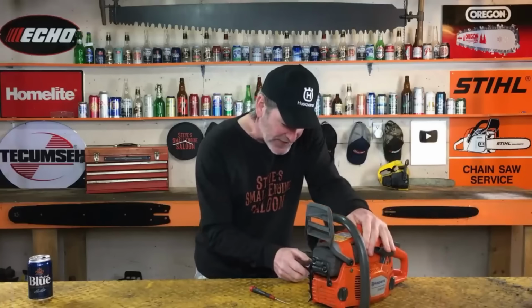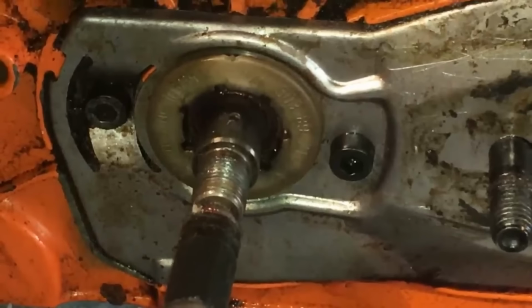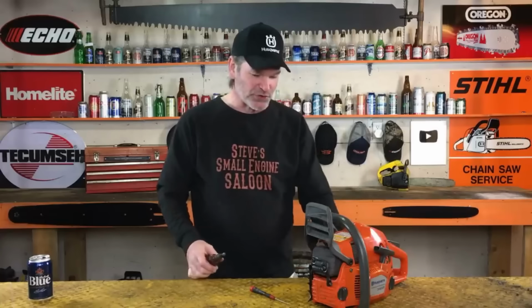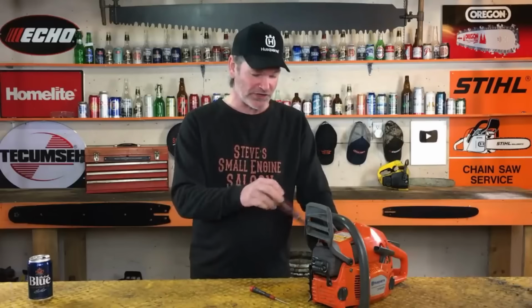You take that same grease gun, you put it in here and you squirt it in here. Look at this. Watch what happens. Boom. You see how the grease comes right out the side? That grease comes out that side hole right where your needle bearing is, so you can keep that thing greased and keep it from exploding, drying out, and seizing up on your engine like this one did.